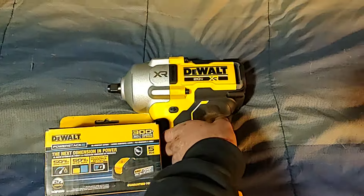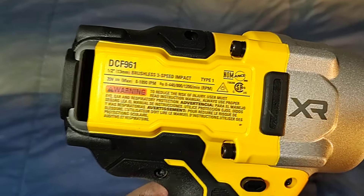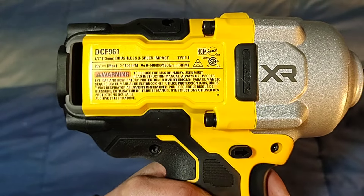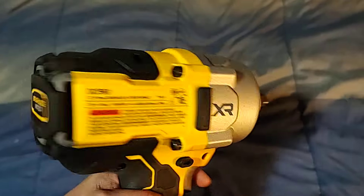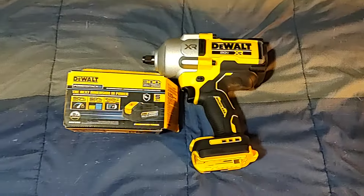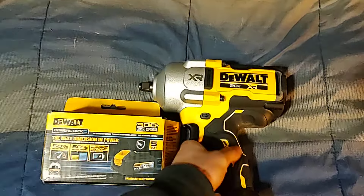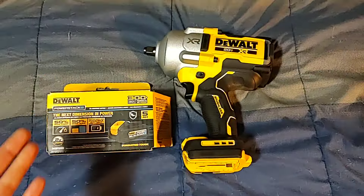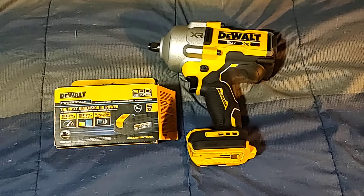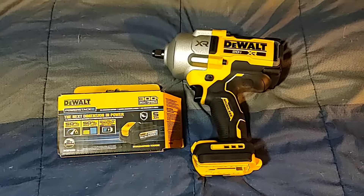So that's why I went with the DCF961 — half-inch brushless three-speed impact, 1,890 impacts per minute, 1,200 RPM. She's slow, but she kicks in after four seconds of impacting with more torque. I'm very surprised they don't offer this in a three-quarter yet — this should be a three-quarter gun, because it's very violent with a half-inch anvil. But this is something I'll pull out when there's something really stuck. I'm sure it'll do it, and if it won't, that's what the torch is for.